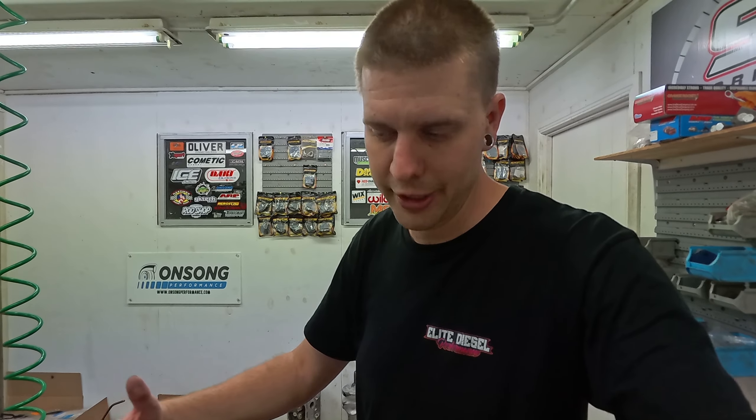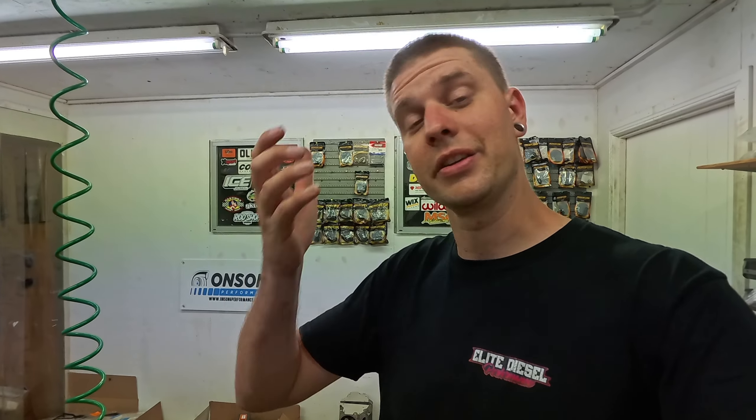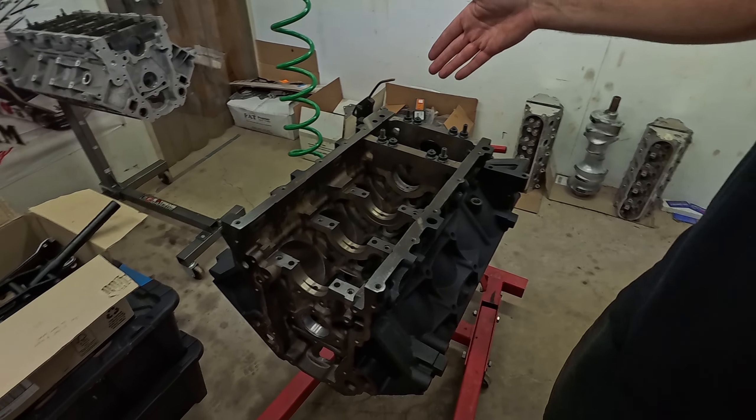We're not going to be running the 1242T from Crow anymore. We're going to put a 1287 in this because they're talking about supercharging in future. The 1287 we like to use for mildly aggressive street cars paired with like a 2800 converter in a six litre. Given this has got a four-inch stroke, it's going to eat up quite a bit of cam. In a four-wheel drive with four-threes or four-elevens, that 1287 is going to be a really good cam — and we know it performs really well with boost too.